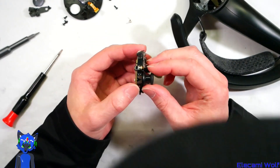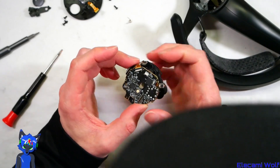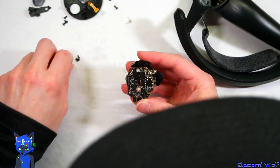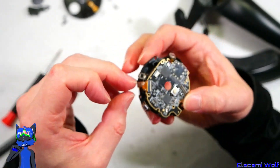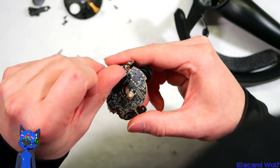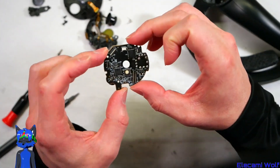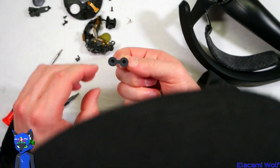If you're replacing the stick you could probably do it now, but you'd probably want to take off the next layer to get other things out of the way. For that there are three more screws — tiny ones, slightly different from the others. There's another ribbon cable to undo by lifting up the little white bit at the back, and that will slide out. Then there's another ribbon cable here — the little white bit lifts up and the cable slides out. Now the button top assembly comes away from the main board, along with the membrane part of the keypad.